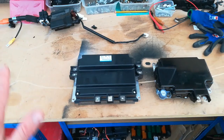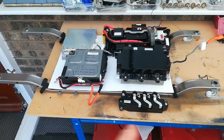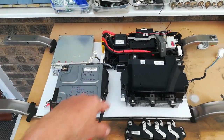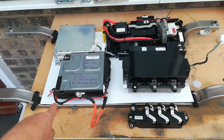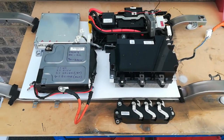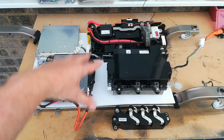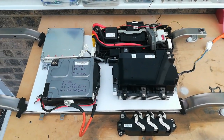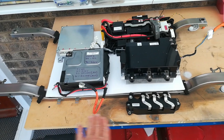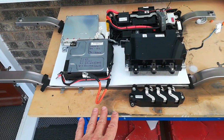I'm basically going to make up a plate — this is going to be a mock-up over here and it'll probably mount on the top just so it's easier to get to. Everything will be bolted and attached to this alloy plate. I'll make a pattern using this polycarbonate material and then get it laser cut, which will bolt to that and all these units will bolt to it. There'll be loads of space underneath for the lithium polymer pack and its own independent BMS.